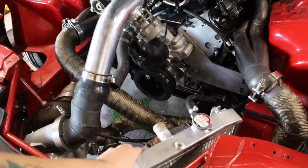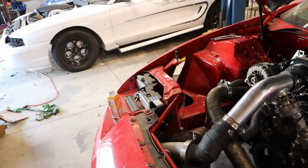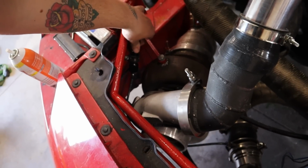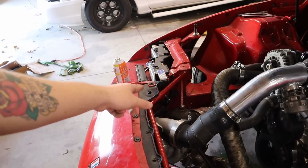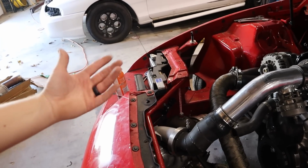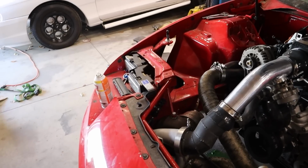And then got the radiator mounted. That turned out great. And then I got the lines for the boost controller all ran. You wanted to put a manual boost controller on it for simplicity for right now, so I got it mounted right here where it's real easy to get to. Nice short lines for quick reference. That should work really well. The thing I like about manual boost controllers on a street car is they tend, in my experience, to have a pretty slow ramp. I think that'll actually work in his favor a lot.